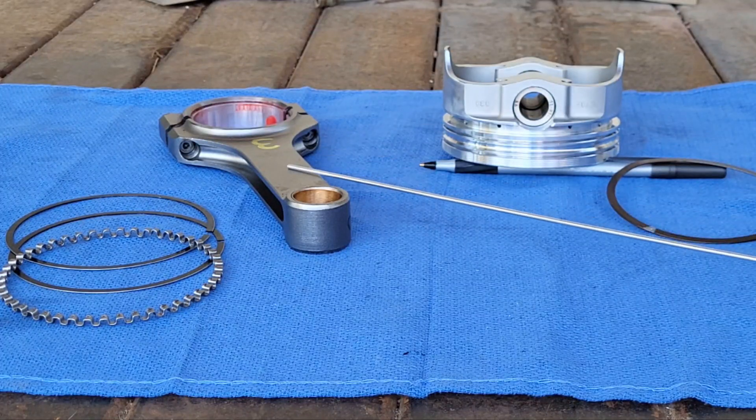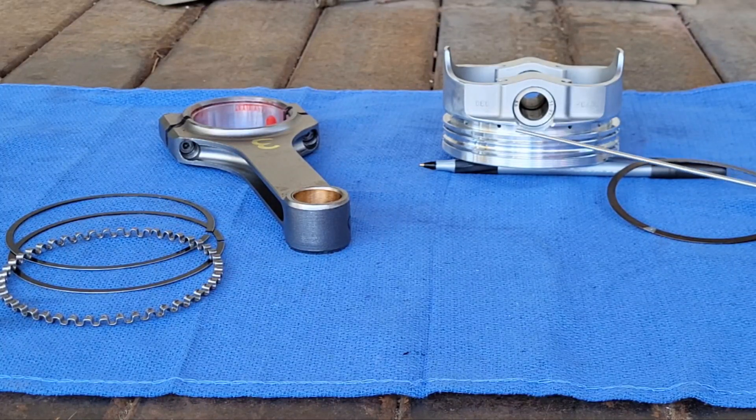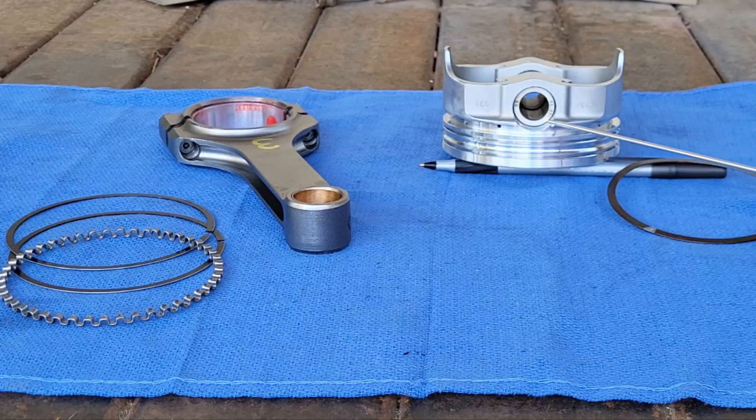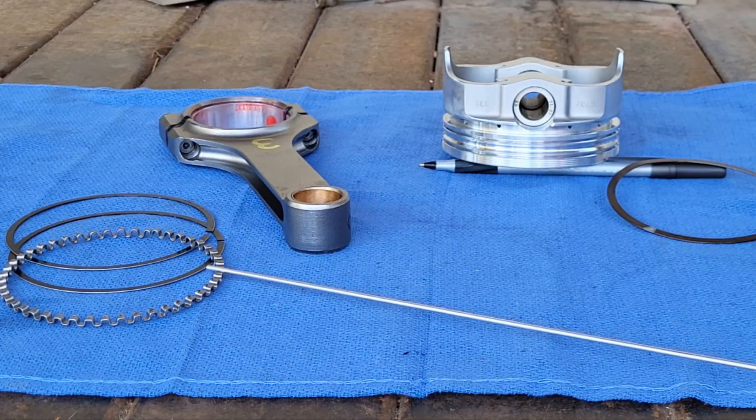Here's the six-inch rod we're using. They had to put the wrist pin somewhere to make the rod fit, so they went into the ring land of the oil control ring. It requires a support rail, which is right here. You put the support rail in first. There's a little bump, and in this configuration that bump goes up, because it's going to get stuck between here and here during operation — it's allowed to move a little bit, but those are the stops, giving us oil control ring assembly support 100% of the time.